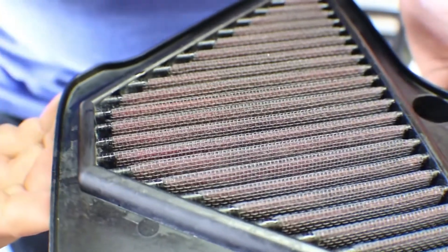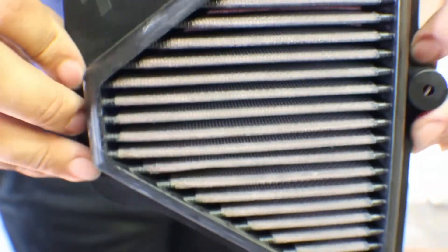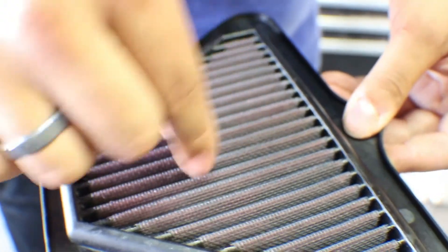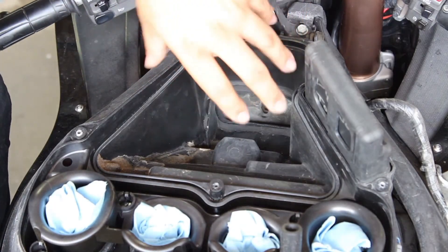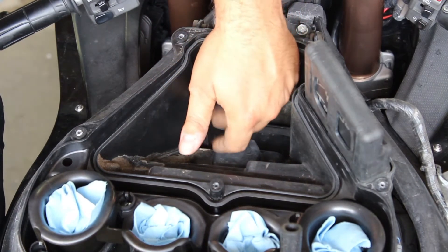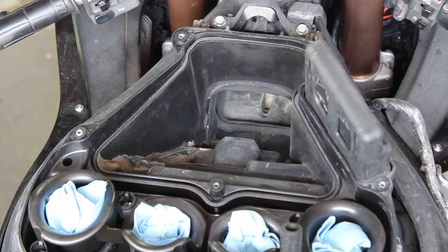Let it sit dirty side up for about 10–15 minutes so you can let the capillary action pull the oil through to the other side. Then check to see if you have even coverage on both sides. If the other side is a little splotchy and blotchy, apply a little bit more oil on the opposite side to those particular areas, and let it sit for another 5–10 minutes until you have even coverage. While your air filter is sitting, look underneath the filter or on the other side in the first section of your air box — you're going to notice there's all this dirt in there. So I'm just going to use a little degreaser and go inside and clean all that up in the meantime.